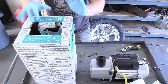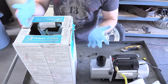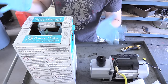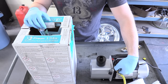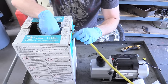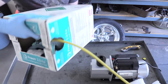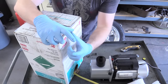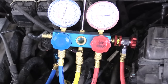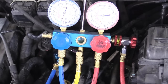There are two ways you can use your refrigerant keg. You can have it right side up — the gas at the top of the canister feeds your refrigerant system, which works but takes longer. What we're going to do is attach our hose to the keg and flip it over, using the liquid, which goes much quicker — that's the professional's way of doing it. We disconnect our yellow line and attach it to our keg. Make sure that's on nice and snug, then open up this valve and flip it on its head. Note that if you're using the little cans, you can do the exact same thing on a smaller scale. When we attached the yellow line to our keg, air got in there, so we loosen it slightly to flush any air out — now there's just refrigerant in this line.